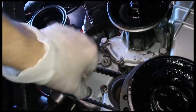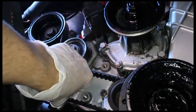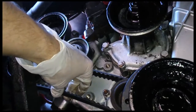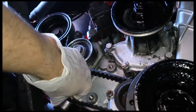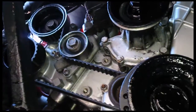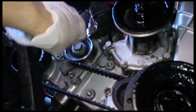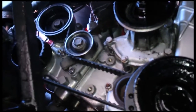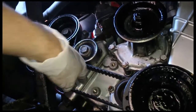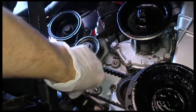So we're going to check the belt tension. If the belt was slack for some reason - that's about right, that feels good already. The method is 45 degrees, 45 degrees, and about a quarter of an inch of movement either way - thumb and forefinger, 45, 45. That already feels right but you rotate the engine and just check it like that. I'm not going to loosen the tensioner and do the other systems like Veril etc., or the Ferrari system, which you can read about. My quick rule of thumb is 45, 45, thumb and forefinger - we already know that feels about right.